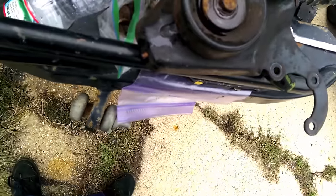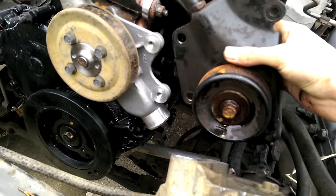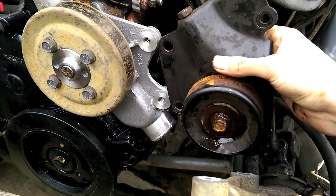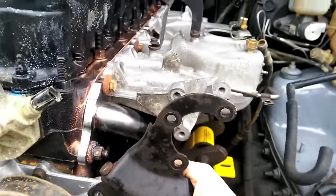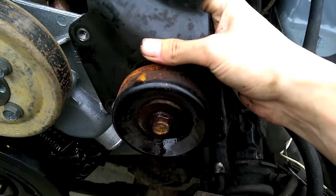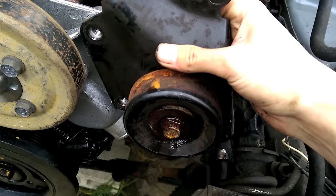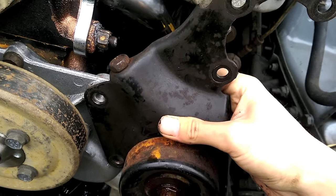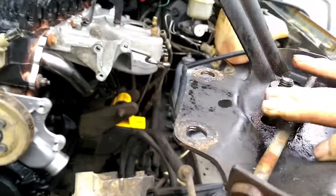This is the new style adapter right here. The way it works is it bolts to the water pump just fine. It bolts on there and then the power steering pump is sandwiched between these two plates. The cool thing with this system is you can reach this pulley, and this will be your new belt tensioner. Instead of messing around with the power steering pump to get it to tilt the way you need it, now this thing just brings the pulley up and down. It's a whole lot easier and you don't have to remove the airbox to do it either.